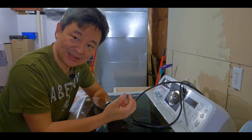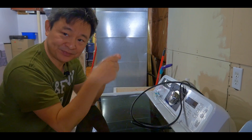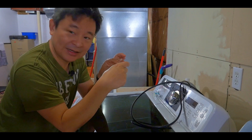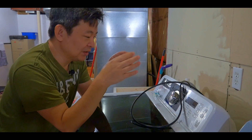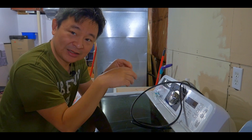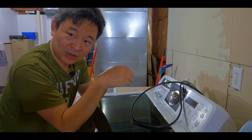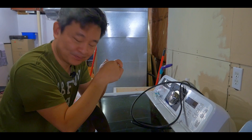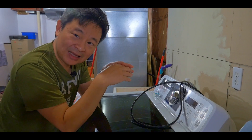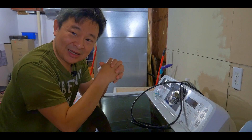For my case it is the valve that is leaking — the hot water section. I'll go to the back panel, unscrew it, and take out the whole valve regulator. I'll seal the hot water side and order the parts from Amazon. I want to make sure I can disassemble and reinstall it — at least seal the hot water section, get cold water working, and once the part comes install it and get the whole thing working hot and cold.